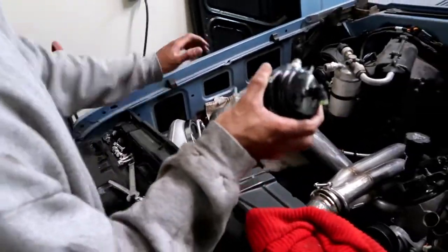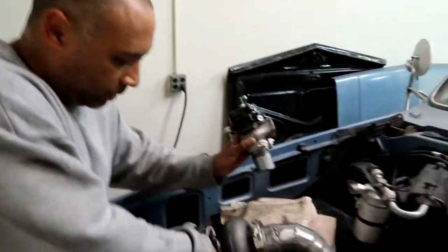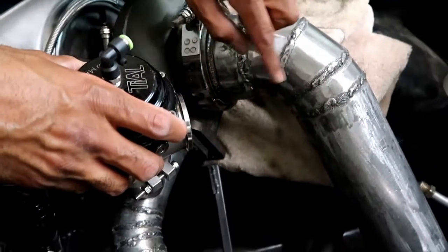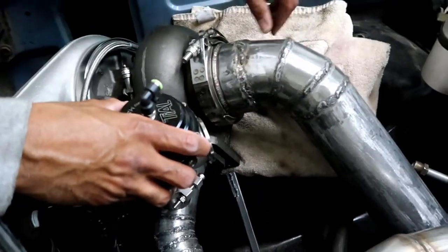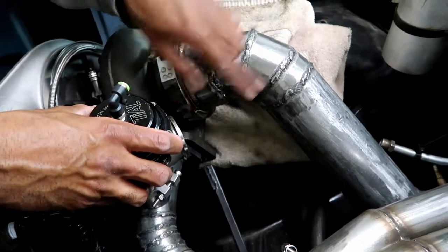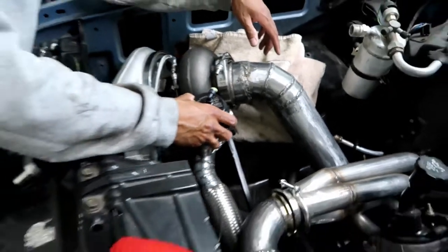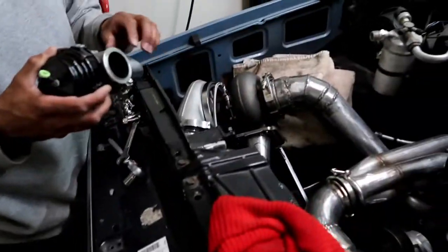Working on the wastegate right now. This is the inlet — we made the inlet pipe, cut it, and traced it. It's going to sit like this, and this little pipe is going to shoot off into the exhaust. I could leave it open but from what I hear that's pretty loud, so we're going to run it in there to muffle it a little bit. The main exhaust, like we talked about, is going to go straight out — I've just about got that done. Right now we're going to drill that out and weld this little piece on there.